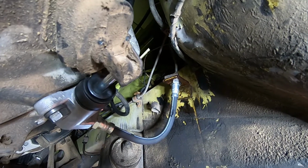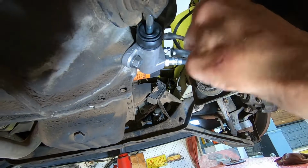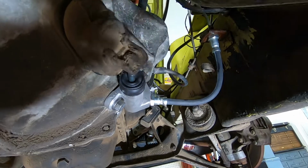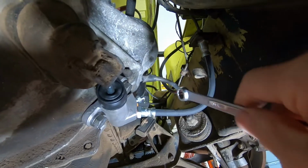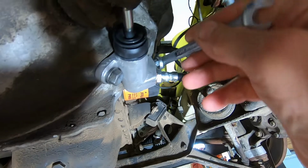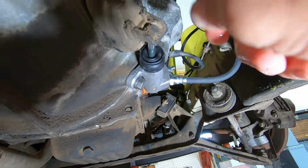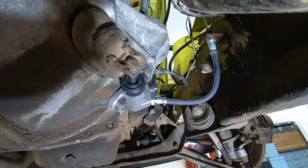And now we're ready to put some fluid in the master cylinder. Okay, to bleed it, you just gotta open this little bleed valve here. And I'm gonna just see if maybe gravity won't pull some of the fluid down. Okay, see that? Starting to dribble out now. Just what I wanted. And that may be all we need to do, because this port is up on the top end of the slave cylinder, so fluid comes down here and pushes any air out, and we may be done. I'll go check the fluid level and then push on the clutch, see how it feels.